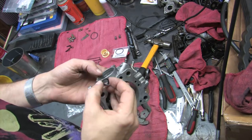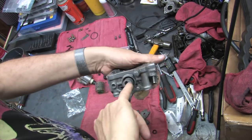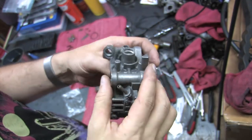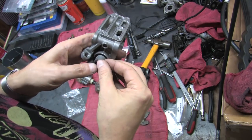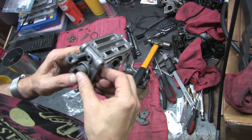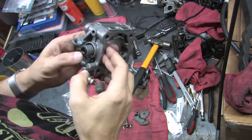The routine continues. Thoroughly inspect the edges and the cleanliness of the seal bosses. Check it with your eyes and your fingertips. Nothing you can see or feel with your finger? Okay then, it's ready for a seal. Place the seal dead center on the hole. Press from opposite sides until it starts to move a little bit, and then look all around it and inspect it from different angles to make sure that it's straight. If you have a high spot, press lightly on it and massage it until it's even with the rest of the seal. Then press from opposite sides again and repeat.